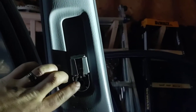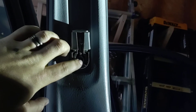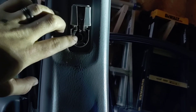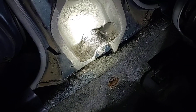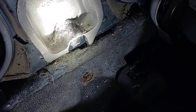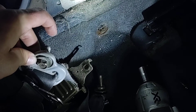I did have a lot of trouble with the upper one — it's extremely tight and it's got Loctite in the threads. So we're gonna take note of that and put Loctite back in it. These are bolts that obviously you never want to rattle loose or start to loosen themselves, especially with a belt constantly swinging back and forth on them. So we've got our old assembly out and we're gonna get our new assembly in. Any bolts that your new belt doesn't come with, just reuse them from the old belt — the bolts should all be good.